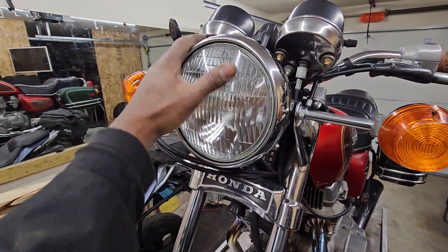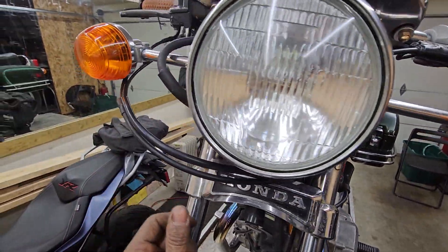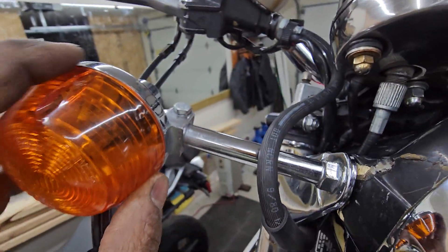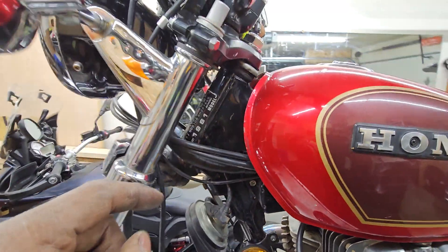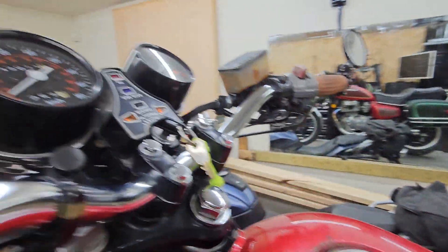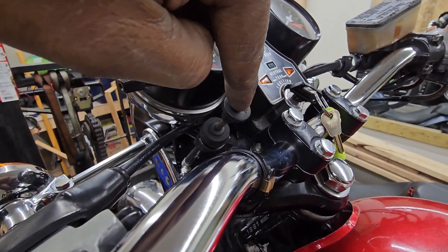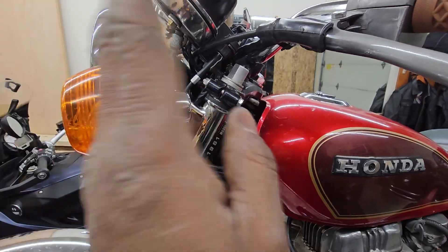Previously your headlight was doing the tilt thing and I fixed that. This was doing the rotate thing — fixed that too. There are some missing fasteners. There's still one I have to dig through my inventory to find, but there was a fastener missing here so I put one in, and this is the computer to your bike down here so I put a fastener in there. I also fixed your clutch lever with a band-aid — this is called race wire. It's very sharp so don't lick it, but your choke cable now officially works. That was just a quick five-minute fix and it will work provided you're not pulling on it like crazy.